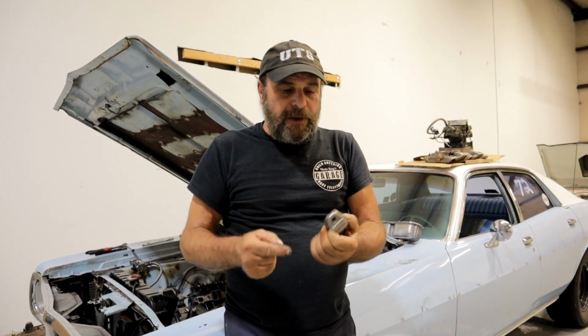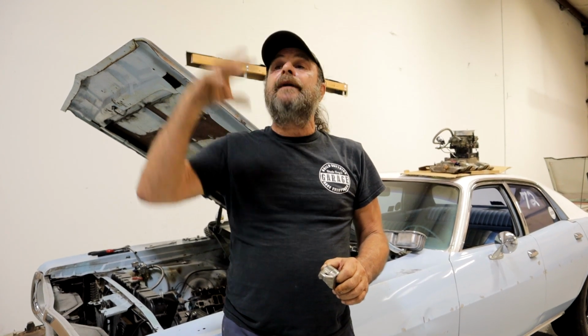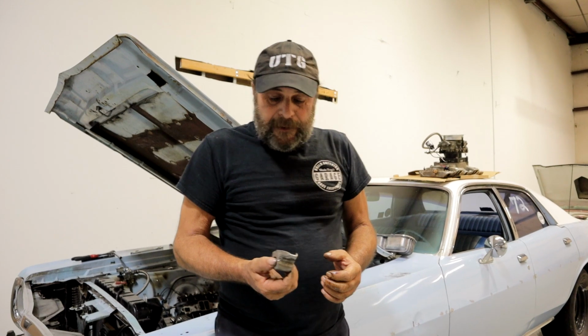That should not make any difference. There shouldn't be any slop here. But if you've got, let's say, one of these lifters that's bled all the way down, and you fire this thing up, and right away you got to give it gas to get it to come up and then idle down, and you feather the throttle to keep it running, typical hot rod stuff without a choke, well, this thing is getting violently punched, and that's probably what caused this. I'll guarantee that's what caused this.